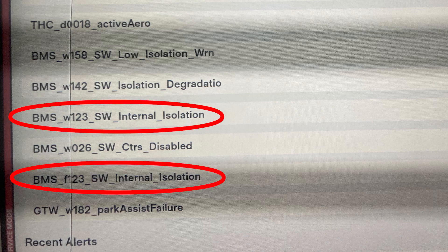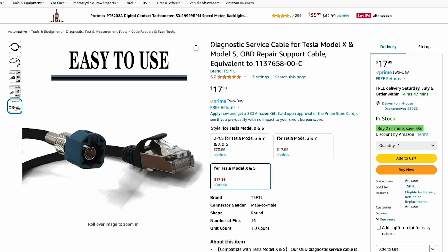Even after we got it all working, it was probably still about an hour that we spent with this guy going through and looking at the errors. We were able to get the 'battery is wet' BMS isolation error cleared out relatively quickly, which was cool. But then there were some other errors, mostly related to the fireman's loop being pulled — essentially one of the interlocks that prevents the main contactors on the battery from closing.